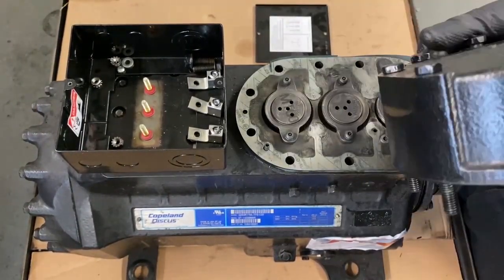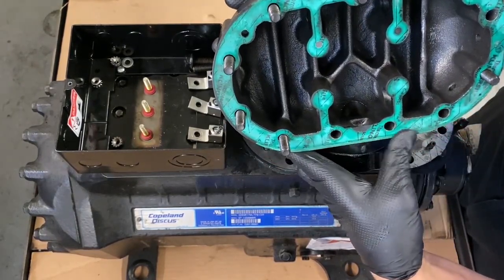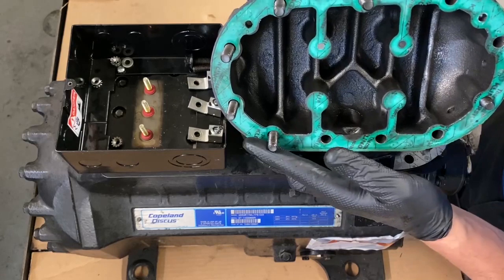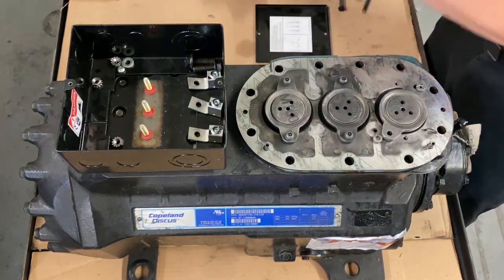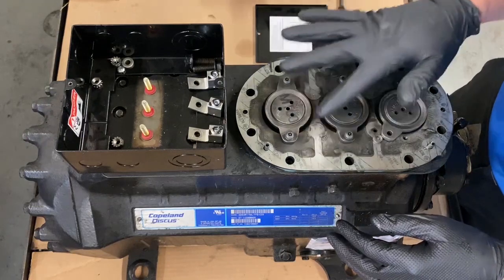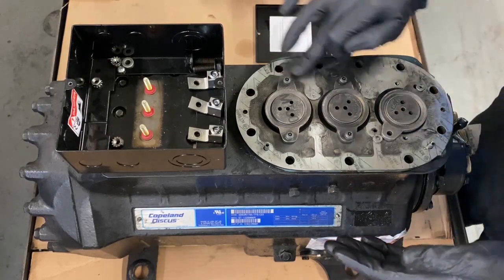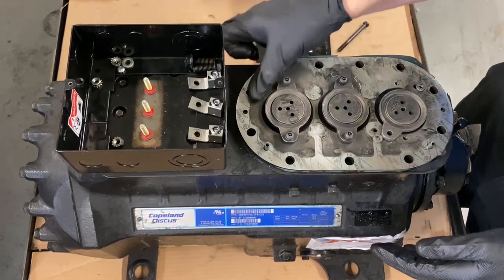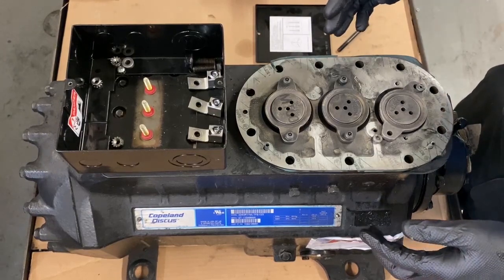What you want to do is inspect the head gasket — make sure there's no cracks. This one here looks okay. You want to inspect to see if it's cracked or if there's carbon tracking in it. I see multiple things right now. A lot of guys, when they see this, are going to say it's overheating right away. But you can see how I'm rubbing that off — that is mechanical wear, that is not overheat. So just be aware of that. This is mechanical wear — see how I just cleaned all that off? Mechanical wear.